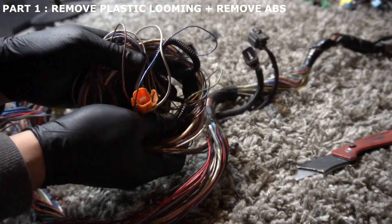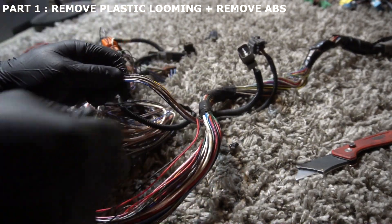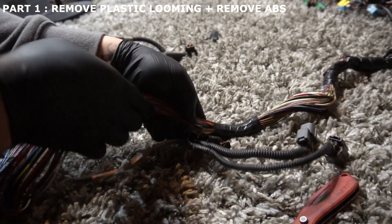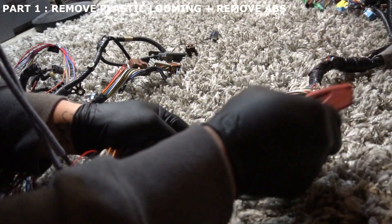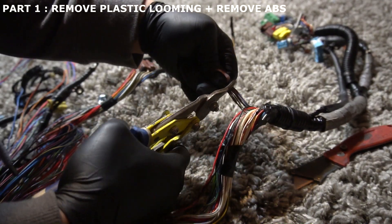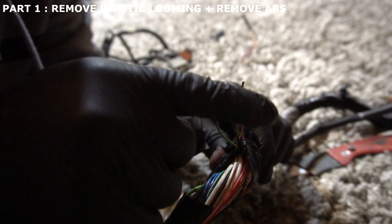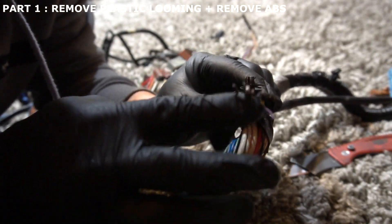If your loop or pile is getting too big, go ahead and cut it here and start a new pile. We're at the O2 sensors — there are two of them, primary and secondary. Right at this point there's going to be a good amount of tape; go ahead and cut that out. This is all ABS-related — cut them all really short. What I recommend is throwing some heat shrink around every single one of these, then tape them together and tape them onto the side right here.